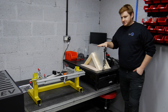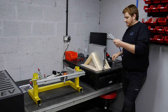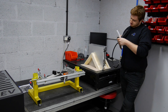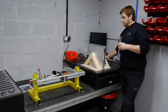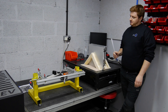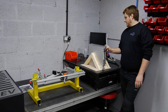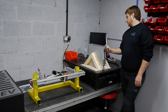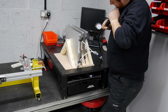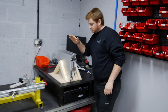First things first, we're going to pressure test these cooling plates. We've made a little setup here that we can basically pressurize these up to about 1.5 bar. What we do is pressurize it and then hold it for a good half an hour. If we've got any leaks, we'll pull apart the fittings and inspect to see what the issue is. If not, we're all good. That will get signed off, then we'll pop it in the jig and start making the module. We'll leave that for about half an hour and come back to see if she's still holding.